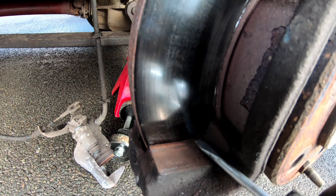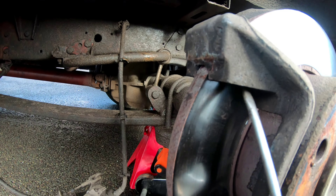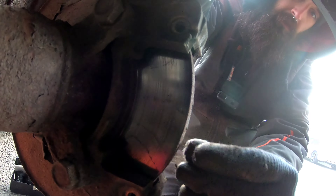Cleaning off the carrier is always a great idea - that's where the brake pads sit in the carrier, so you want to keep them as clear as you can. Get them cleaned back, all four. It's always worth giving the face a good sand down as well. Any standing corrosion on there results in wheel wobble, alignment issues and all sorts. I cleaned these off - clean the face off. Check the disc for any minor cracks or uneven wear. This one seems to be all good.